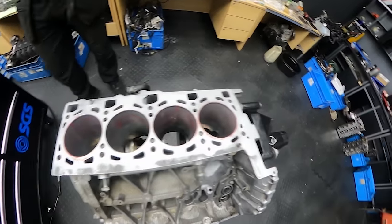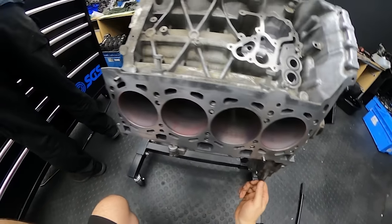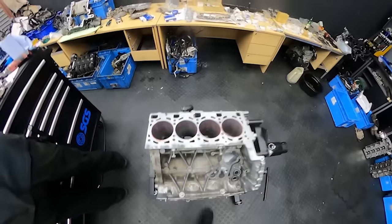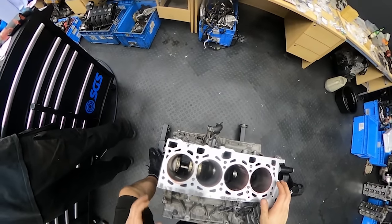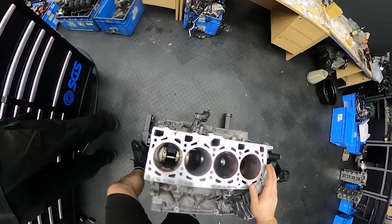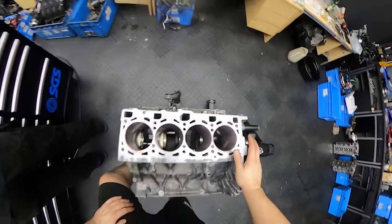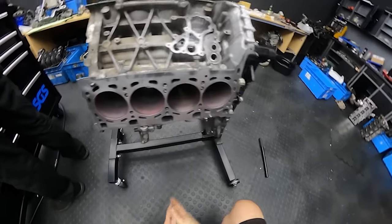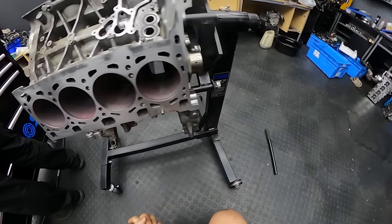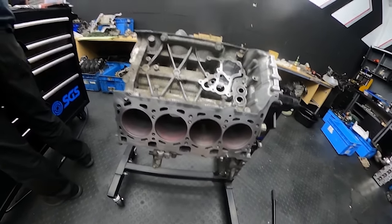Okay guys, so we put a bit of lubrication onto the walls of the combustion chamber. Miroslav's getting ready piston number one with the conrod, with new bearing of course. And the plan is every single one we put in, we will put the bottom cap on, tie them, and as soon as all eight of them are in, we will be tightening them down slowly, and we're always gonna check if it's actually turning, because if we get to the point that we tighten them and the crankshaft won't turn, we will have a problem. So let's start with number one.